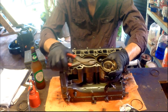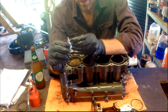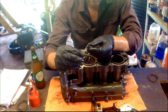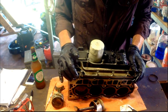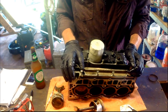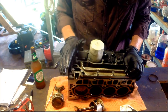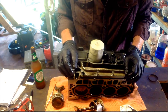The weights of the rings are quite different, as well as the profiles. The second ring is definitely both thicker and taller, which makes it pretty conclusive — this is the top ring, this is the middle, and these are the oil control rings. I'm going to go ahead and take all these old rings out, then clean the grooves. Some people swear by scraping a broken ring through; others say never put metal near it because the clearances are quite specific.